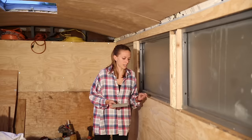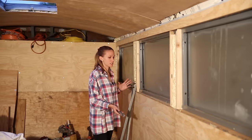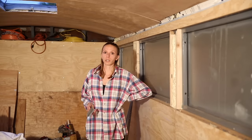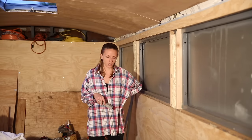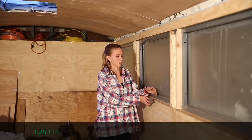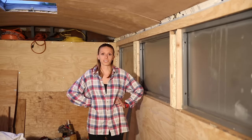What we've been doing, because our application is a little different, started out using wood filler. But once we did one wall and saw how much it required to fill it from side to side, we realized we'd be using a lot of it and it would add up really quick cost-wise. So we made a switch over to using all-purpose putty — we got a giant gallon for a really good price, and that's what we plan on using for filling and feathering out the edge.